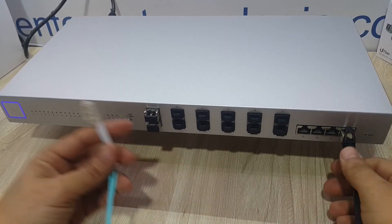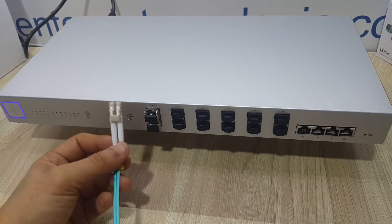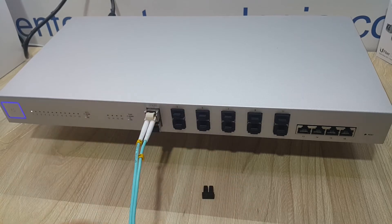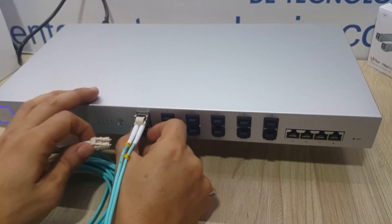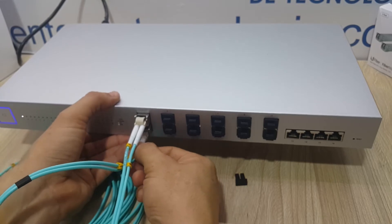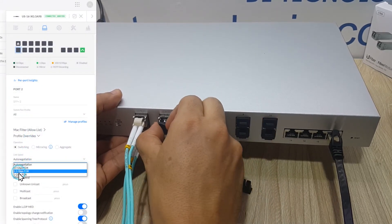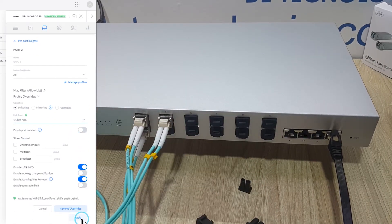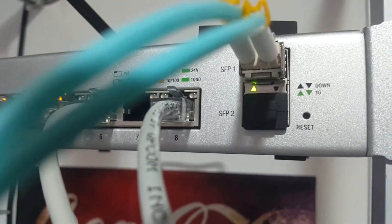Once our device is adopted, we start plugging our OM3 optic cables, which is straightforward. We can see that once connected, it is going to blink white when it has an active 10 gigabit per second connection and blink green when connections are at 1 gigabit per second. In this case we're going to connect the SFP ports — one for the UDM Pro, one for the US24, and one for the US8. Future videos will show how this 10 gigabit technology can free your network in terms of availability, storage, speeds, and cloud access. Remember that the UDM Pro has a 10 gigabit WAN connector, meaning it can support a 10 gigabit internet connection.